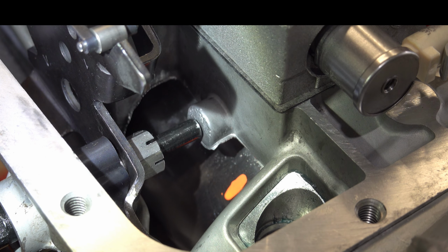I always like to do that because it's a good before and after, just a muscle memory comparison, so that even if I'm within my supposed band travel spec of 1/8, if I'm feeling drag, then that means I'm a little too tight and I need to further fine tune before I call it good.